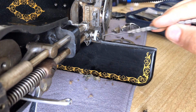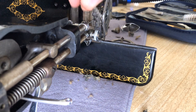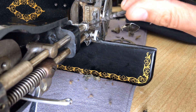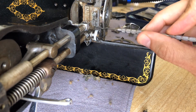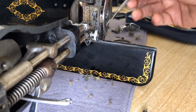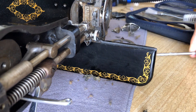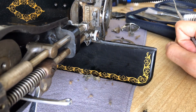It really is amazing how strong these machines are — they actually still sew in spite of all of this lack of maintenance. There's some still stuck in here. I'm going to look and see if there's anything behind that upper piece. We can certainly remove it — just unscrew it, it's not hard. With my little tool I'm getting underneath the feed dog, and you can see more lint moving and escaping.